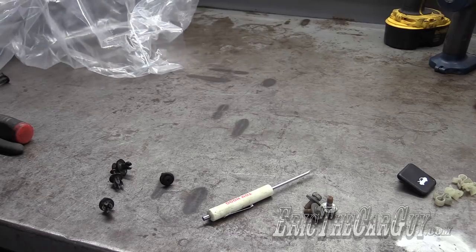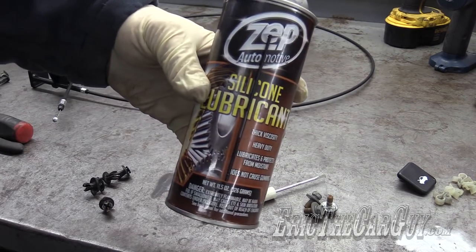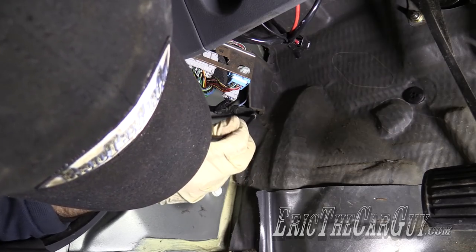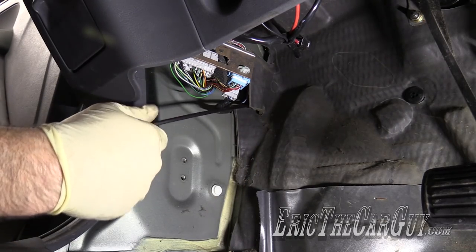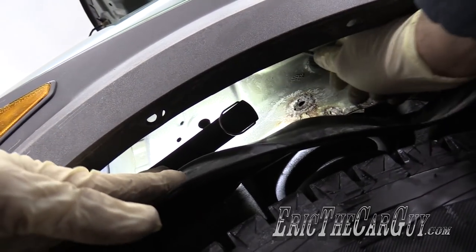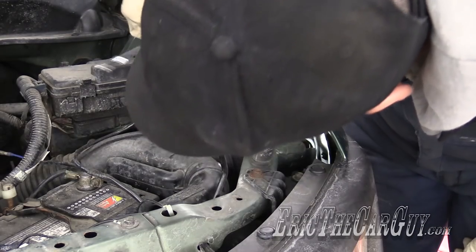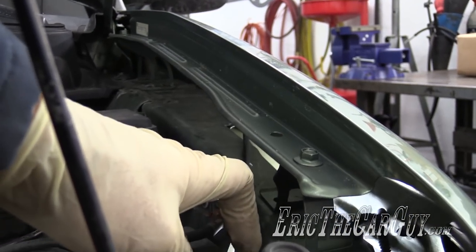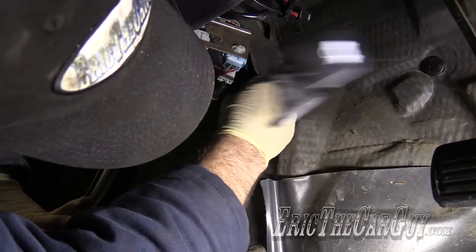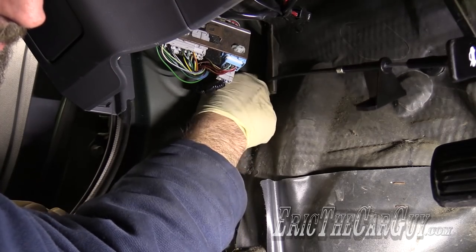Looks like it's broken in two places. Shiny new cable. I'm going to spray this little rubber grommet with a little bit of silicone spray, and that will help the installation. Really just the opposite of what I just did — let's start it through the opening and keep on going. Here's the cable; I'm just going to point it up and see if I can grab it. It goes on the inside here because it's clipped down right there, and also clipped down here and here. I'm just going to feed that rubber grommet into place — push it in. That silicone really helped.